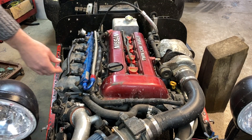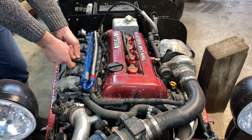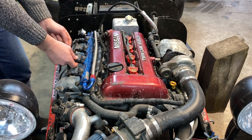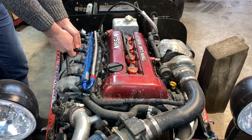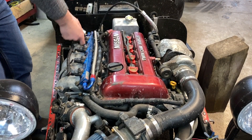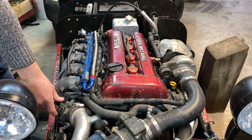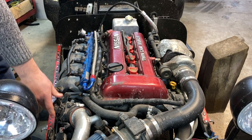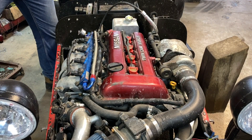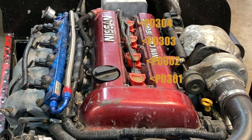It's not running on all four cylinders. It doesn't mean that my ignition coil is bad. It just means that for some reason, either there's no spark, there's no fuel, or there's no compression in that cylinder. If this was happening in your car right now, it would be giving you a code P0301. The 0300 series indicates misfires. 0-1, 0-2, 0-3, and 0-4 indicate the specific cylinder that is misfiring.